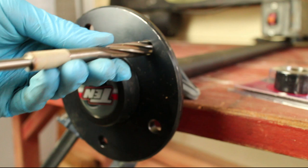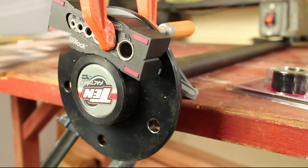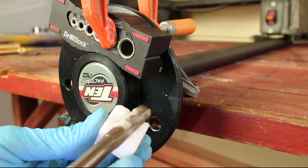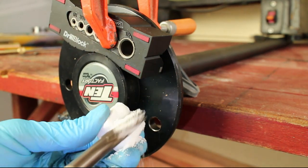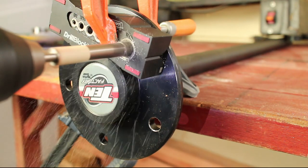This is the perfect application for a half inch reamer. I do not recommend a drill bit for this application. Use a drill guide and drill lube to ream up the 5 stud holes. Ensure that the holes are reamed perfectly straight.